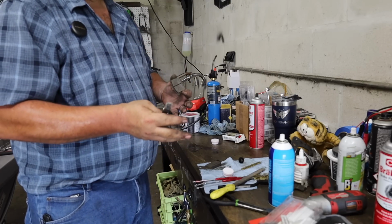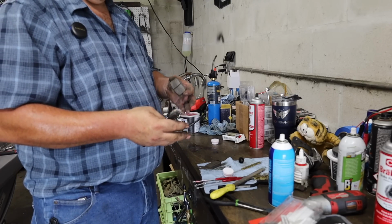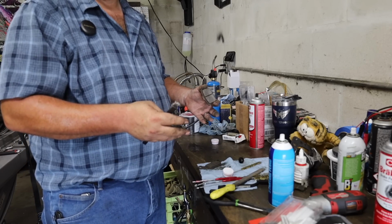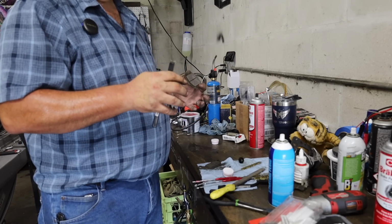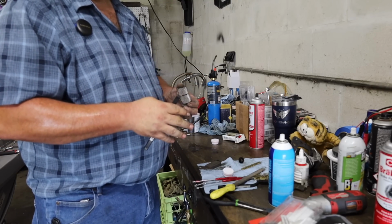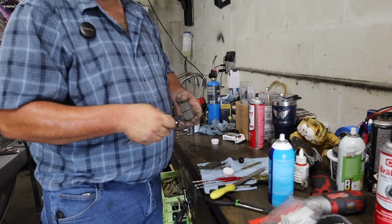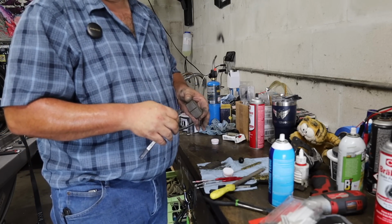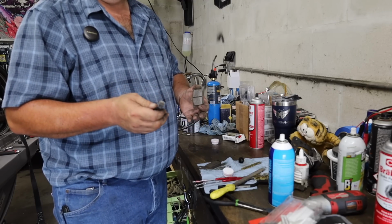Because if you had one set of pads that was biting at, say, 50% efficiency, and its next door neighbor was biting at, say, 80% efficiency, whichever side has the more bite to it will try to draw the bike off one side or the other until both sets of pads even out. It doesn't happen very often, but it can happen. So go ahead and take a few extra minutes. Make sure you're not putting yourself in that kind of a situation on the front side. That way you don't have to scratch your head and wonder what to do about it on the back side.